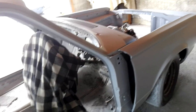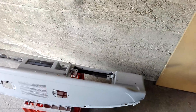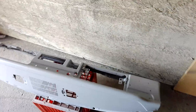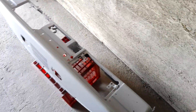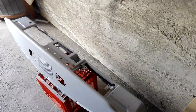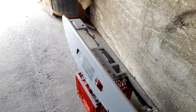We'll give it another good couple of coats before we get into the final sand back and all that stuff before paint. And I've tidied up the worst of the dents and marks in the dash. I've given that two or three good coats — hopefully a bit of a rub back and that'll look pretty reasonable. It might need a little bit of spot putty in the odd place or a little bit of that dolphin glaze just to smooth out any last pieces I'm not real happy with.